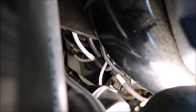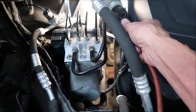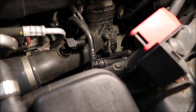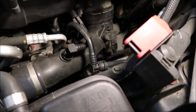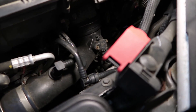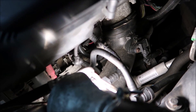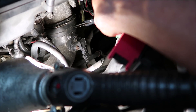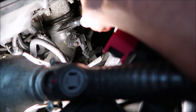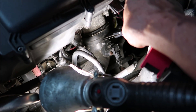The repair is complete. That white colored line you see in the center of the picture is that silicone line. There's one other spot I would recommend you check while you're here — over on this side on the intake pipe, they are known to crack. Mine is not cracked yet, but a crack on the intake pipe can generate the same fault. That crack normally appears around the body of the pipe, and a lot of times the body will be cracked along in here, which will supposedly also throw the same fault.